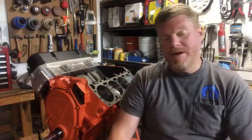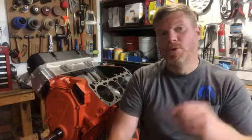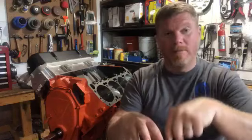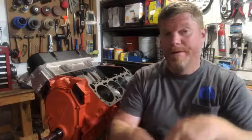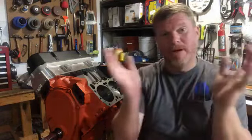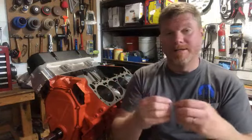Depending on the supercharger wheel that you put in your Sea-Doo or your Yamaha, or you change the wheel on a Cowie, then you start altering how much fuel needs to get in there, because now you're shoving way more air in. If you don't meet that with an equal amount of fuel or added fuel, you're going to be leaning out your engine. You're going to have not enough gasoline for your intake charge, and the actual intake combustion is lean. It's actually hot because the gasoline isn't burning all the air in there. Did I lose you on that one?